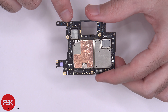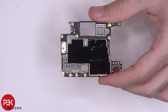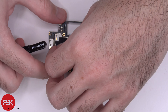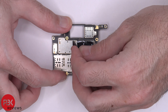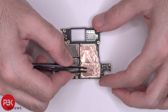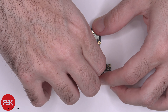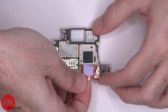One of your microphones is located on the top. Here's the back side — this is your SIM reader. There's some graphite film on the back as well — let's go ahead and peel that off. There's also copper tape covering your processor; peeling that off reveals the thermal pad underneath on top of your processor.